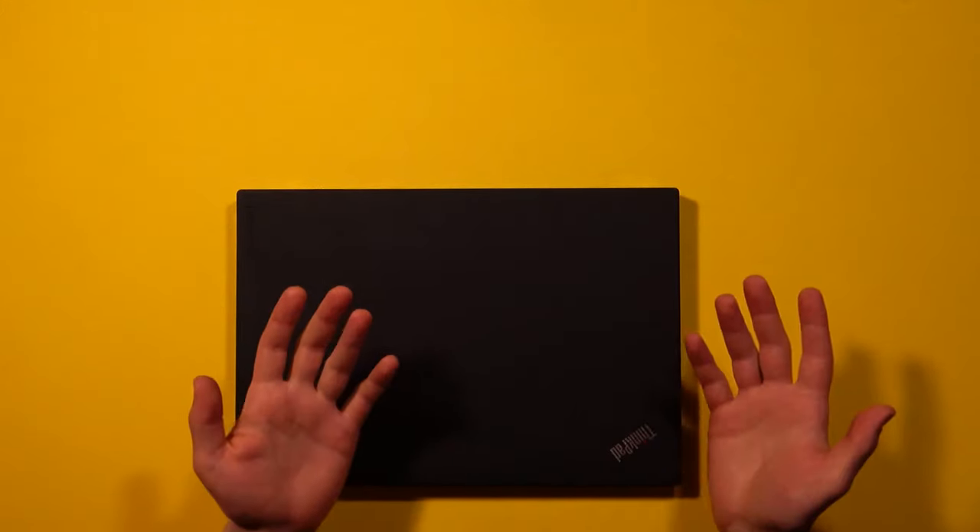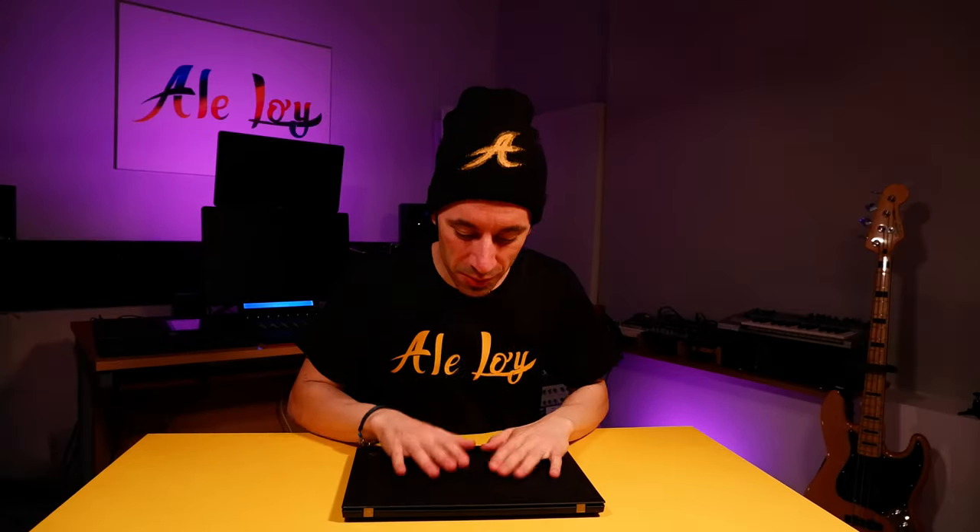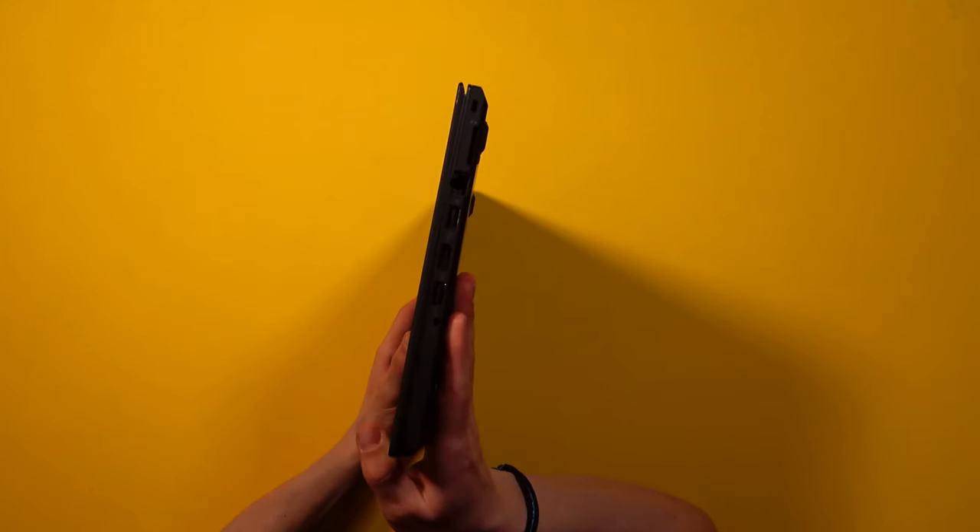In fact, the first reason why I love this laptop is that it's got ports. It sounds like nothing, but it's got ports. The future may be Thunderbolt, sure, but the present when it comes to music is still USB — and actually it's not even USB-C, it's USB-A. Thunderbolt is faster and directly connected to the motherboard, but there aren't many music devices that are Thunderbolt, and those that exist are really expensive. The reason number one why I love this laptop is that it's got three USB 3.1 Gen 2 ports.